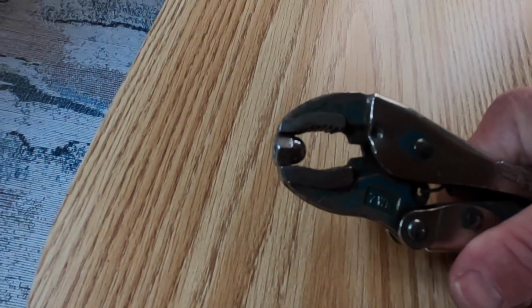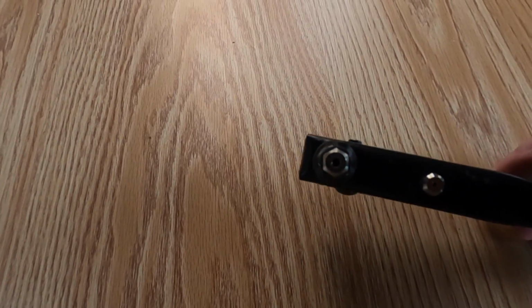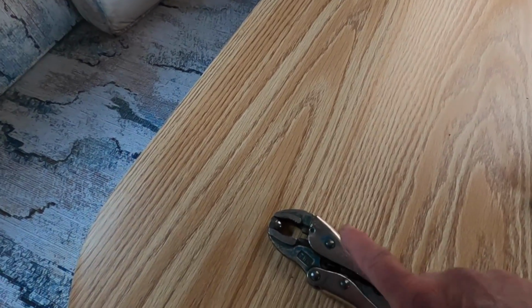So what I will do is I'll get an assistant to hold this inside. And sometimes you have to press a little bit from outside with the rivet gun, so that's why I'll put the dome nut into a pair of vice grips like this, and I will have my assistant sit in here and press that onto the rivet while I push the rivet into the dome nut and then squeeze the rivet squeezer, and that's all you've got to do. Pop the little cap back on. The rivet squeezer looks like that. I'll show you in a minute, but the rivet shank goes into that hole right there, and you give a couple of squeezes on that, and it pulls the shank out and expands the rivet inside the dome nut. So I've got to go find somebody to hold this piece for me.